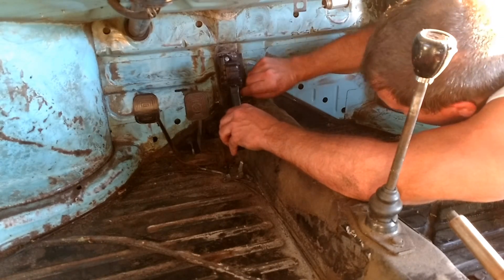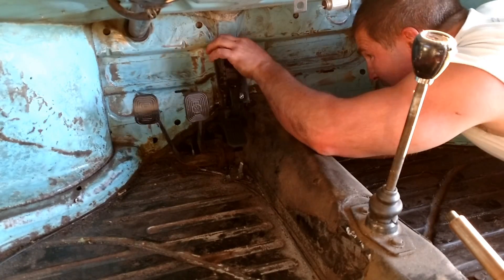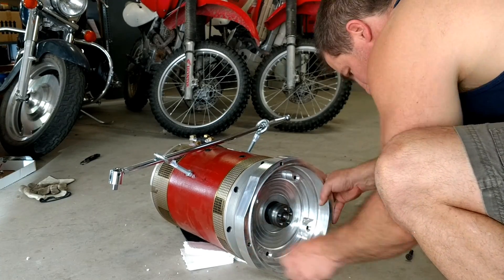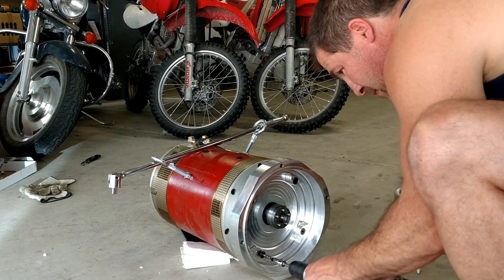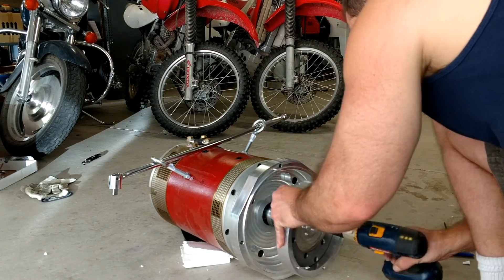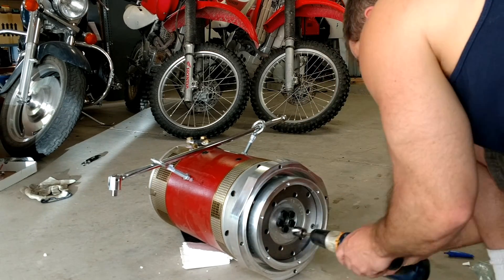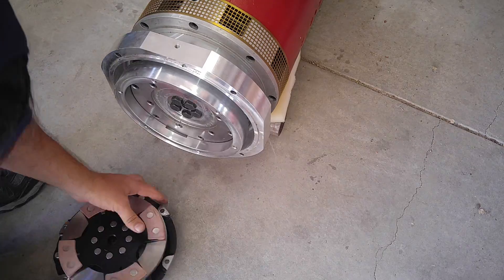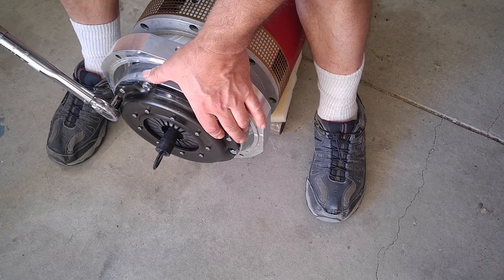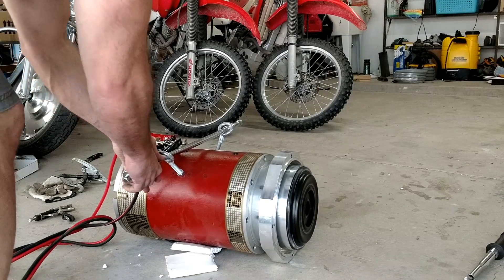Every connector had to be individually made. Had to improvise a throttle mounting bracket since in 1974 Volkswagen didn't realize I was going to put a Toyota Prius throttle in it. Installing the motor coupler and the adapter that connects it to the transaxle, and also a specially made lightened aluminum flywheel — very light. The flywheel doesn't have to have any amount of inertia on an electric motor, but it does serve as the backing plate for the clutch pressure plate. Then installing the stage 4 Kennedy clutch.